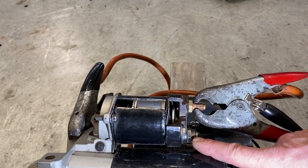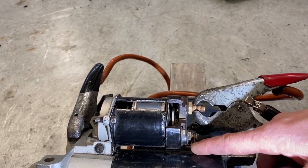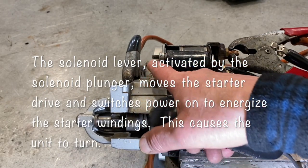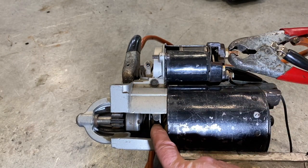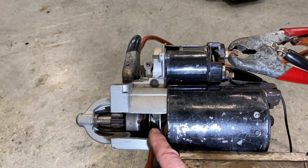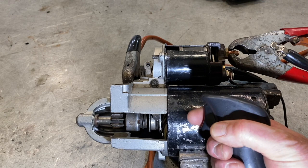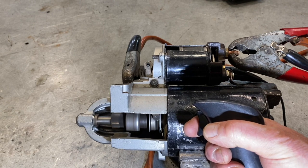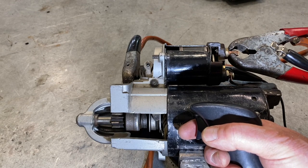Initially, what's first happening is the motor doesn't actually turn over until the plunger comes back. Once the power is joined from there to there, then the motor turns over. You can see what happens with this business end of the solenoid: there's a lever coming down attached to the plunger with a pivot point like a fulcrum, and a fork on the end of the lever that activates the collar on the starter drive assembly, pushing the starter drive out into engagement with the flywheel. You can see the starter drive being pushed out and retracting when we let go of the key.